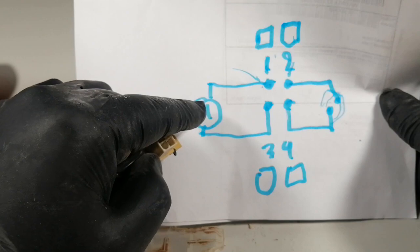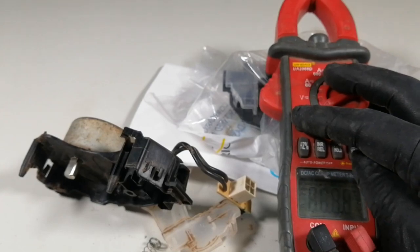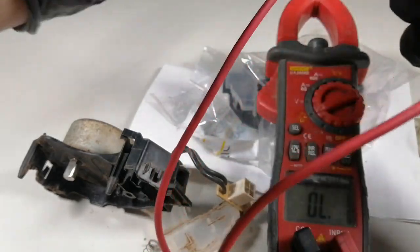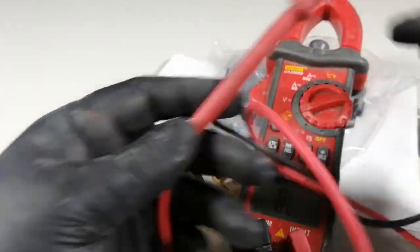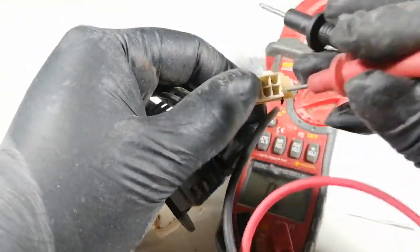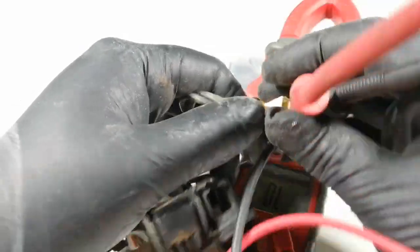Now we are going to check the switch or micro switch of the actuator. How to test it with a multimeter on the lowest resistance scale or on the continuity scale. Remember that if you want to test it in series in this model you can also, because it is only a switch that comes out. If you see that it has other components, do not put the series in, you are going to damage it. If it is not damaged, you just have to put the terminals, and we are going to test to see if it is true that it is failing or what is wrong with it, the motor, the switch or the wiring.